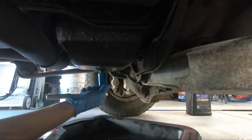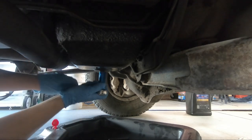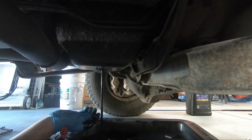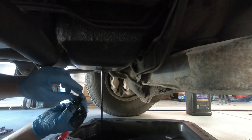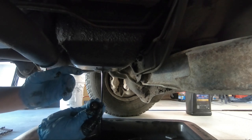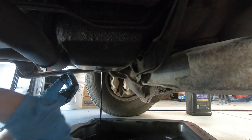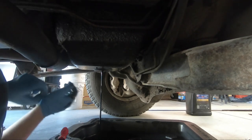Here we are on the truck for the oil drain — it's 3/4-inch for anyone who cares. The IDI has roughly 10 quarts of oil in it. I don't think the oil's been changed in a long time, but it looks like regular diesel engine oil. There looks like a magnet here — let's check it out. I'm not seeing anything, so I think it's a healthy motor. It sounds healthy, drives healthy; it's just an all-around good truck. I think the chassis might have high miles, but it's a really good engine.